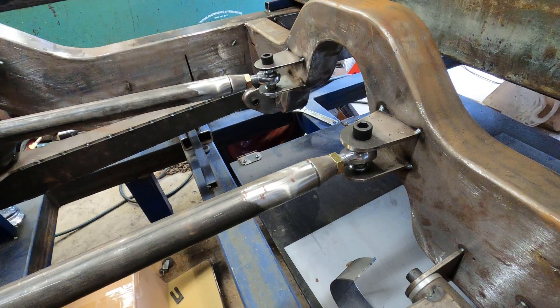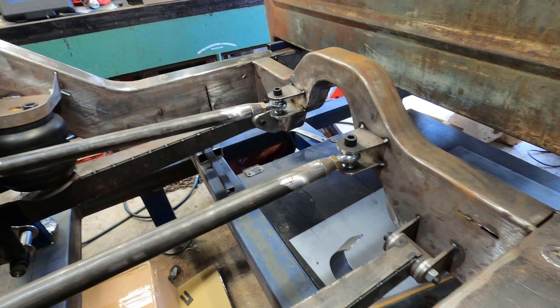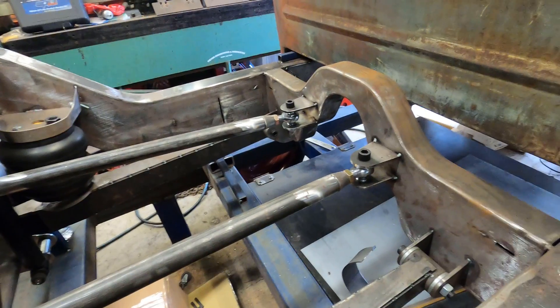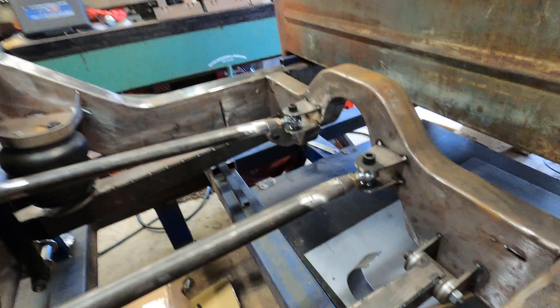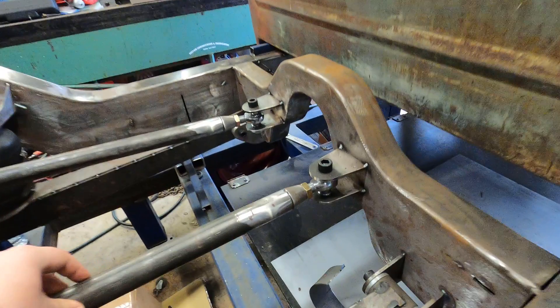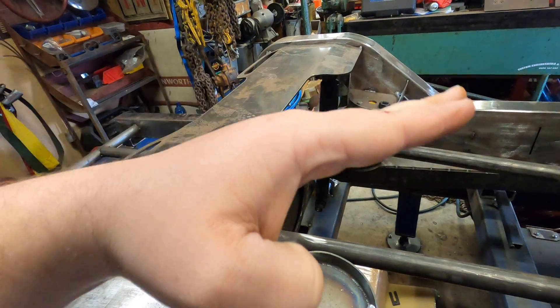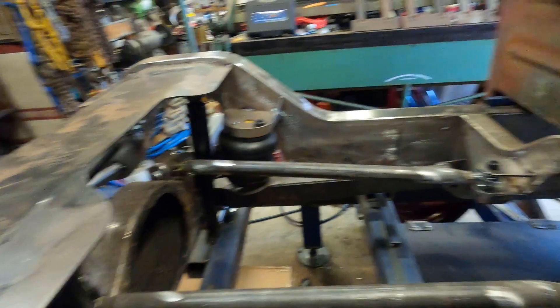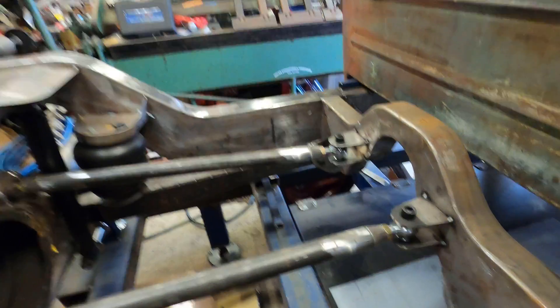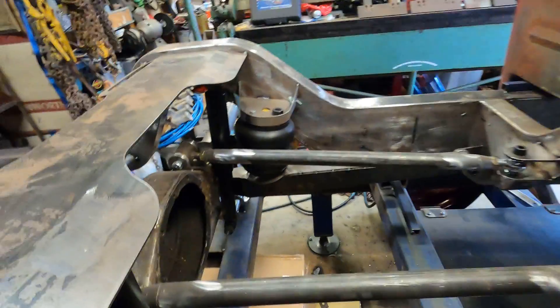On this application we've obviously used them in the front — it gives us our up and down articulation, and we've decided to run them horizontal. I did read something from Pandemic Publishing on the reasons behind that; I just wanted to give it a go and see how much better it rides, see if it gives a little bit better articulation. So I've run heims on one end and a poly bush on the other — a poly bush isn't actually going to give any articulation without crushing the bush, so the heim at one end gives that articulation through this joint, not through that one.